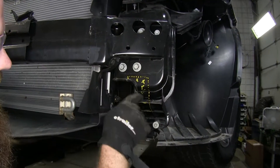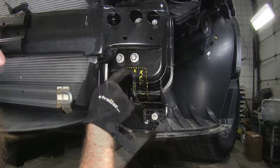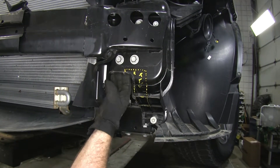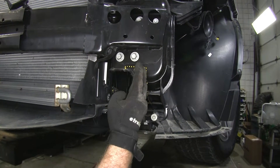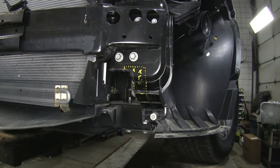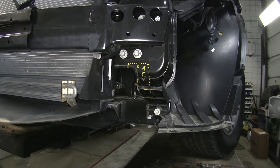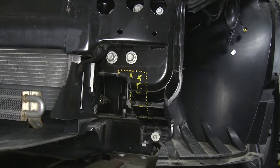Now, on the bracket here, I've gone ahead and marked out the area to be trimmed on each side. I'll be cutting out this section, which is going to allow me to get flush along the bottom edge of that inside frame rail and then flush with the outside of the frame rail so that the base plate can slide up into place. I'm going to use a reciprocating saw to begin cutting that out. If you don't have a reciprocating saw, you could also use a grinder with a cutting wheel or anything that will cut through this cleanly.